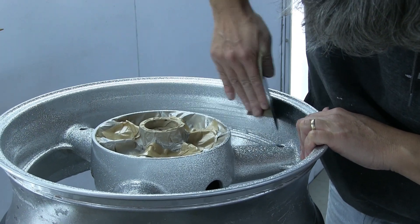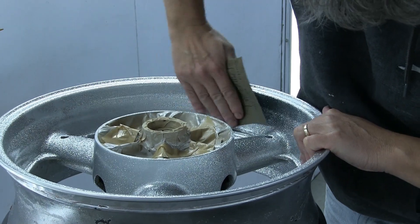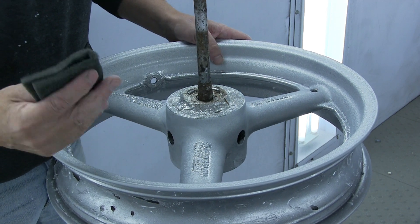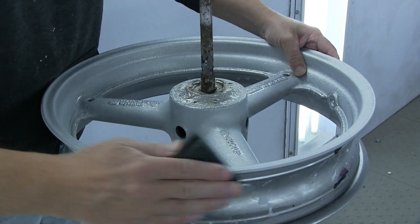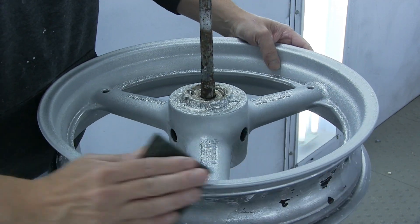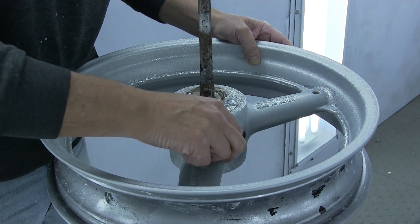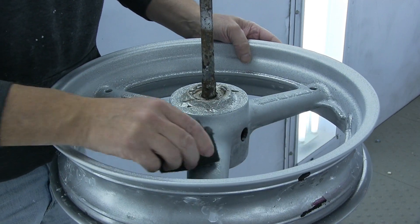On more awkward areas I need to be careful — right on the edge of the rim, sandpaper could cut through pretty quickly. In that situation I swap between the 1000 wet and dry and a grey scotch brite — not red, it needs to be grey. I just double it over and I can go around sharper edges like the rim edge, and I'm much less prone to sanding through the flake. For really awkward bits like the casting, I'll quadruple it — quad it over — and that lets me get in there and knock it back where there's really no way to get sandpaper in.